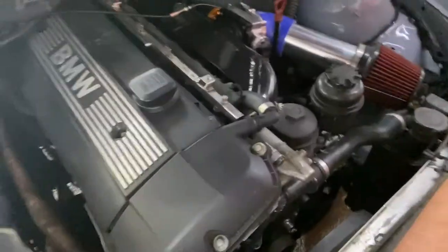This car has been about two years in the making. A good mate of mine called Hanu has been helping me because obviously during the week I can't always work, so it's been at his shop working on it little by little. It's basically a 3.2 litre motor going onto a 320 gearbox — 5 speed — and onto an 1800 diff. It's also been governed to rev to about 3,400 revs because it's still running in, with only 460 k's on the clock. As soon as this lockdown's over, we're going to take it off the governor and install the aircon piping.